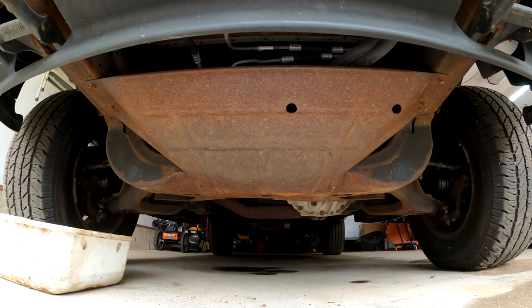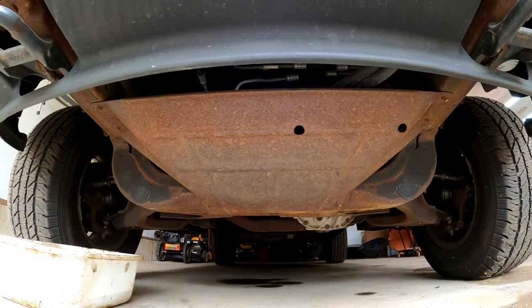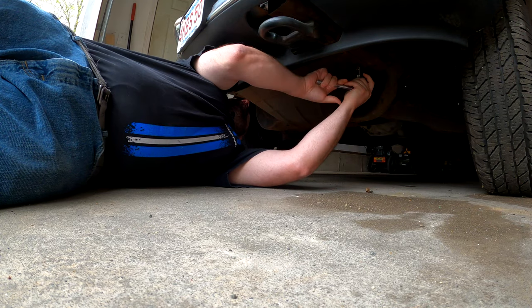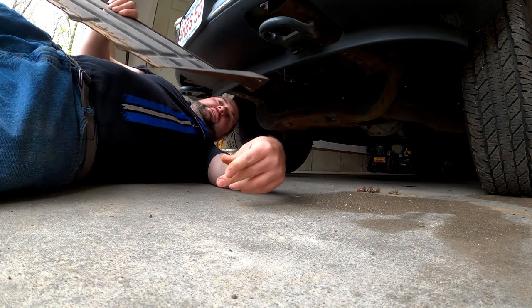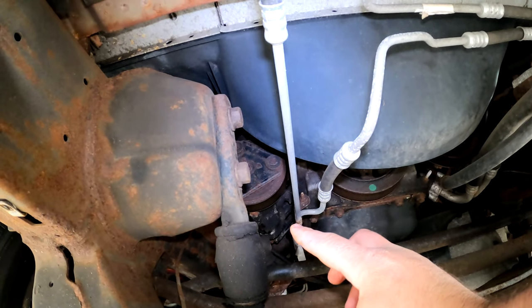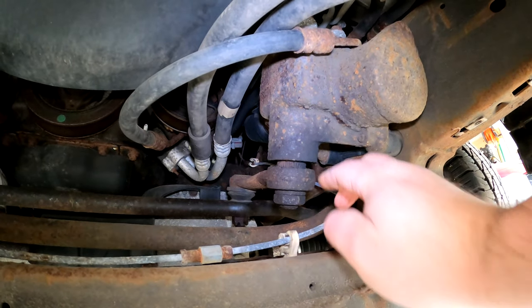If your truck is equipped with a skid plate you'll want to take that off. There are six 10mm bolts that hold it on. We're going to take that off first and that will expose the steering box on the driver side and the idler arm on the passenger side. These bolts may be tricky if you've never had this pan off before. With the skid plate off you should have pretty much full access. This is what it looks like with the inspection cover off. We're going to start with our idler arm — removing it first will let the center link drop down and give us more flexibility to work on the pitman side.